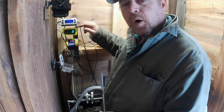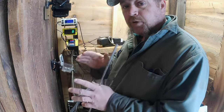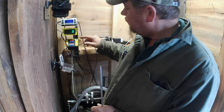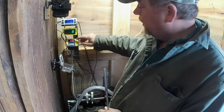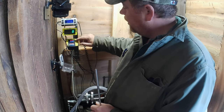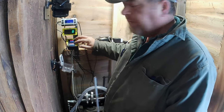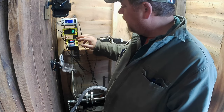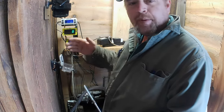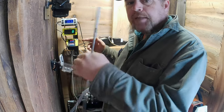To back up — with the correction factor defaults, 10 foot-pounds on the scale equals 1.59 foot-pounds on the saw. So it's a big number shrunk down, which theoretically makes it more accurate. This is the first time — I just got this done yesterday — I put another temperature screen in here. The red numbers on both displays are ambient temperature, and they're 1.3 degrees off. This is not scientific hardware, but I think it's going to be calibrated the same give or take each time, so we can see rises and falls, which is what we want.